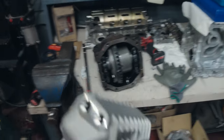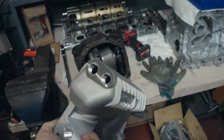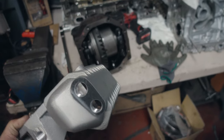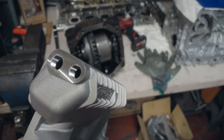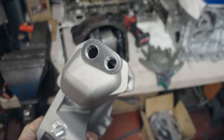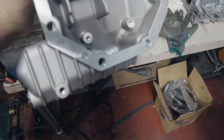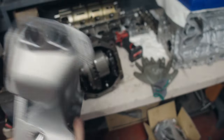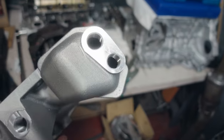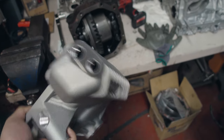To make this diff even flashier, we have the Greddy diff cover. The reason we went with it is to increase the fluid capacity of the diff, which in turn helps with cooling. What's really cool is they have bungs already in the cover for running a cooling system — if you want to run a pump and an air-to-fluid cooler you can do that. There's also a bung in the back for a temperature probe. If you're not using those, they give you covers to plug them up with Teflon tape. This is going to be a really nice piece and I'm excited to slap it on.